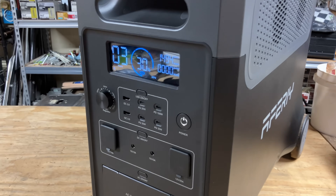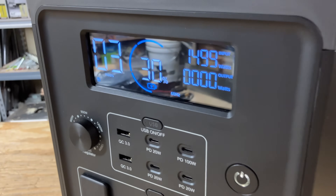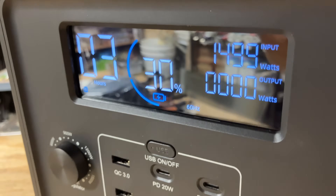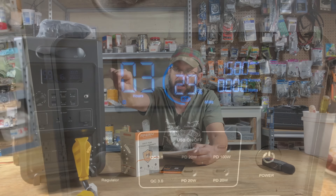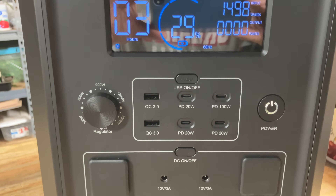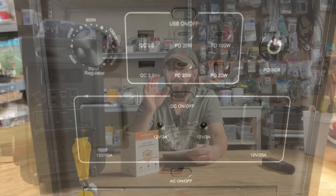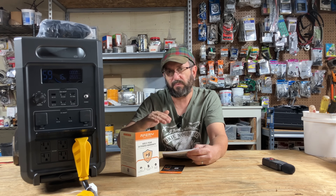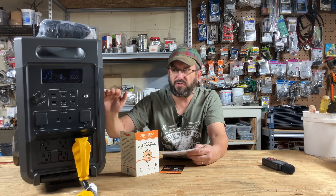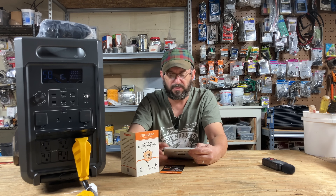The charging was solid — AC charging was incredibly solid. You can do both AC and solar. There's a dial on it where you can turn the charge rate down so it doesn't charge at the full 1,500 watts. In general, with lithium iron phosphate, if you charge it slower it's happier. So if you're not in a rush, you can dial it all the way down to maybe 600 watts or even less, and it'll just make it last longer.